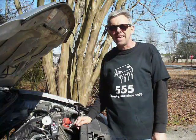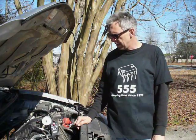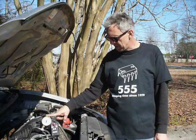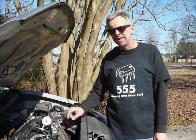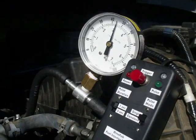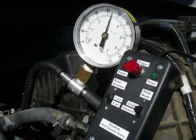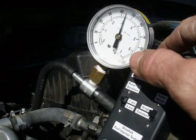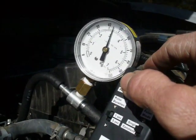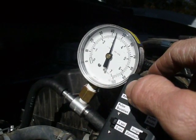It's a beautiful sunny day here in North Carolina and I'm ready to test my fuel injector tester. I've got the fuel pressure gauge hooked up and the tester connected. The fuel system is pressurized — you can see about 45 pounds on the gauge. I have the injector tester set to a single pulse of one second. When I push the button, you'll see the pressure drop as it bleeds off fuel and pressure into the injector I have connected.